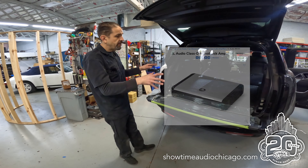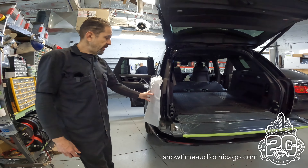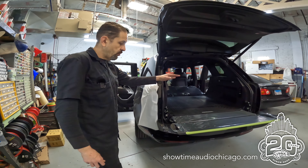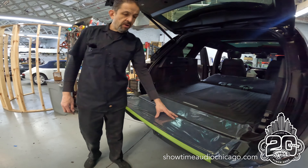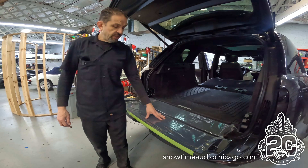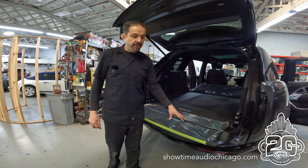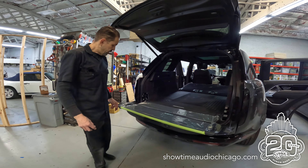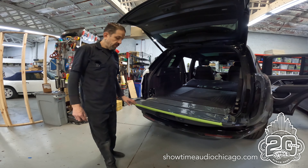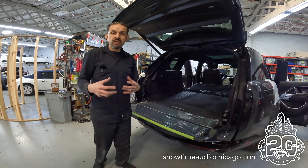So we're prepping the car to work on it. As you can see, we have all our crash wrap tape on the outside to protect the body wherever we're going to be working so that we don't scratch it. And then on the interior, we have our interior crash wrap tape — this protects us from getting the car dirty or marring the carpet or any of the new vinyl. And we tape the edge just to keep the paint protected, so this is actually on the paint itself.